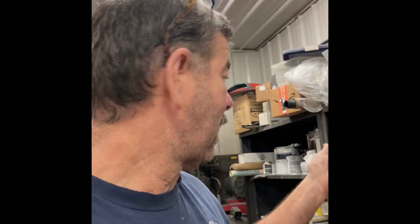Sometimes it gets too much. You really just spray it on, then you come back and spray it again, and then it'll wrinkle. I've done that before, and it wrinkles too much because it's a real light crinkle wrinkle on those hubs. But if you let that happen and then just sand it slightly, it'll take out a lot of that very coarse wrinkle, and then I'll spray black paint over it. And then that whole top part of the column matches well.